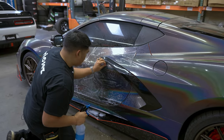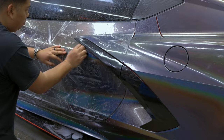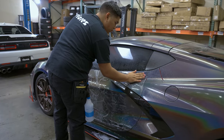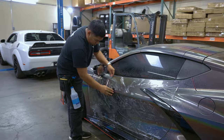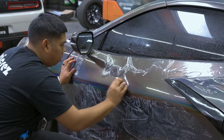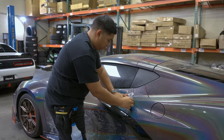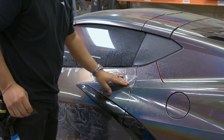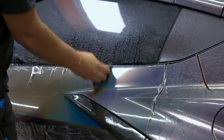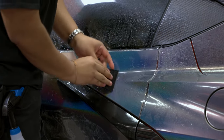Now that we've got all that set, we can start tacking all this under the door handle. Peel your film back, grab your tack solution. Now we're going to tack the top edge — squeegee on this body line and just work your way up. Where we have this dip in the middle of the top edge of our door, squeegee with your hand and follow it with your squeegee. If it lifts just a bit on the edges, grab some tack, spray your tack solution there, just squeegee and hold it.